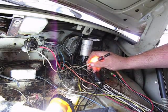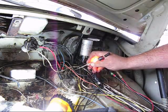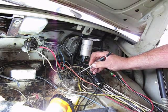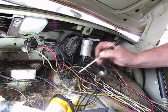It goes through a fuse here, and this side is dead, which tells me that this fuse right here is dead. I'm not getting fire to my headlight bucket because it's breaking down here at the fuse. So I have to replace this fuse — that's the next thing to fix.